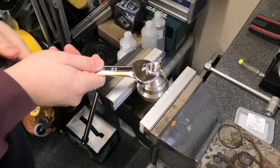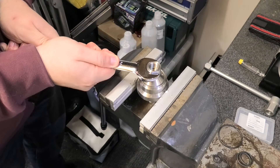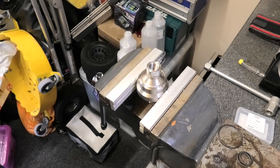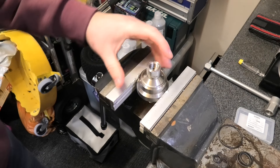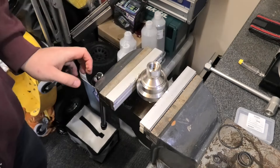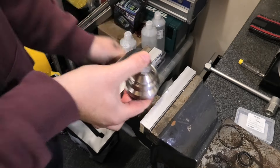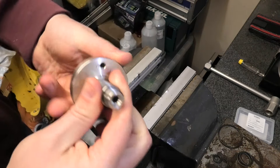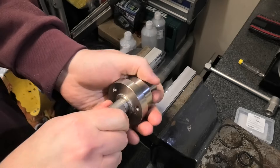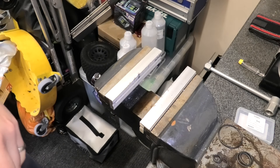A little bit of lube on the top o-ring will help it go in without too much of an issue. If you put the o-ring in dry it may catch on the body on the inside and risk splitting. Once you've got that in, just do it up, nipping the nut up with your 22mm spanner. You might have to put a bit of force on your vice to hold this — a couple of nice flats on there would have made life a lot easier, but just do it up as tight as you can. The thread locker will do the rest. As you can see, the whole process isn't that hard — as long as you've got access to a few commonly available tools, especially a vice. Lovely and smooth — back to how it should be, no notching, no crunching.